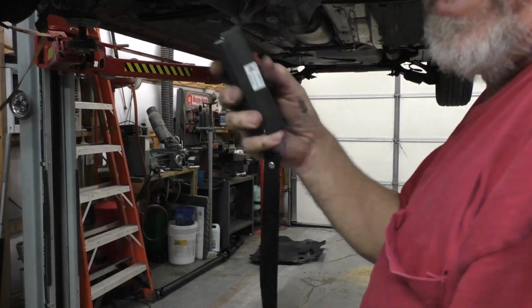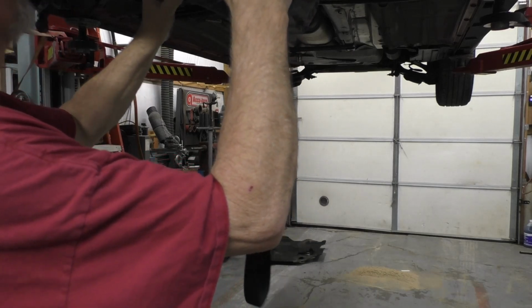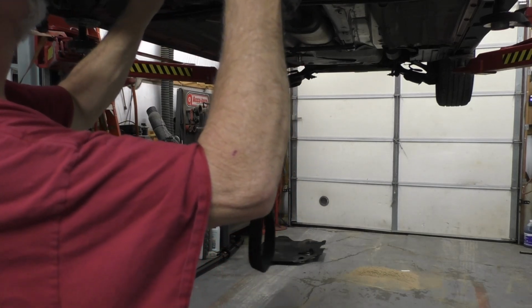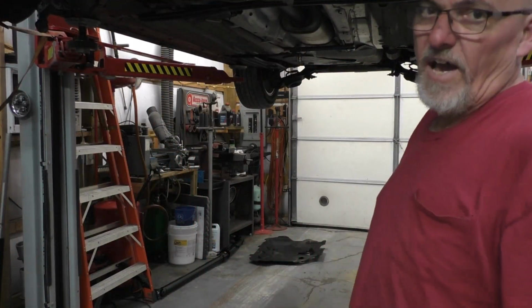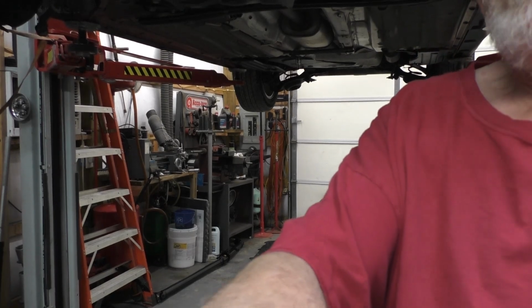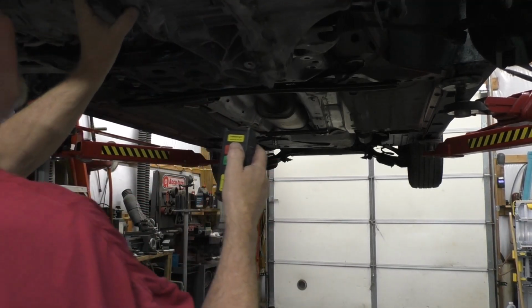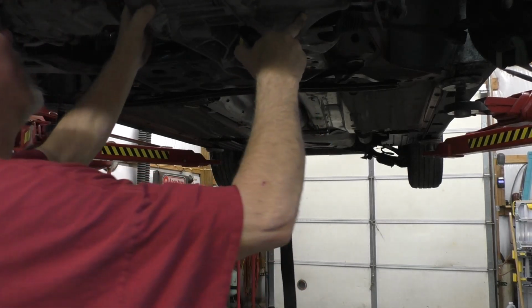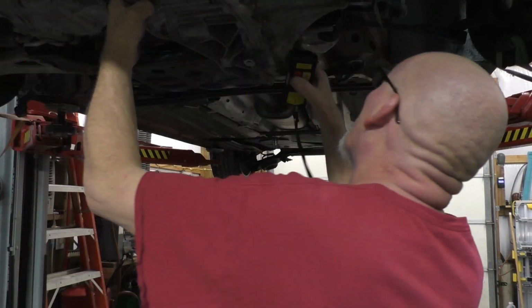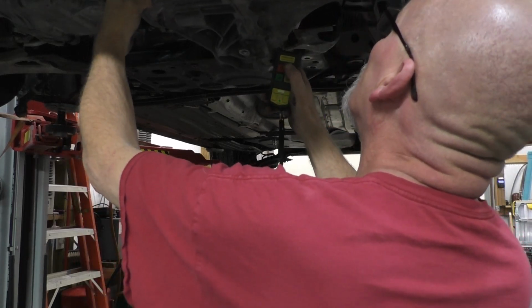that's a downside working with something like this, because that gantry up there, it doesn't care. It's just going to keep pulling. Matter of fact, it's going to pull the whole entire car. It's 1.5 tons, so do your math. That's 3,000 pounds. It don't care. It'll pull that car off the lift if you ain't careful. Of course, here is the funny part. It's going to be a little bit more tricky, because it's going to want to do some silly stuff. This thing is probably going to want to roll on you.